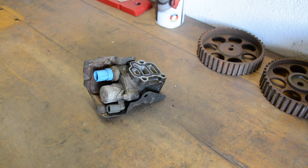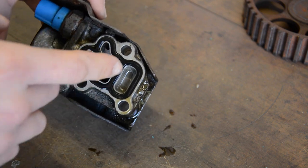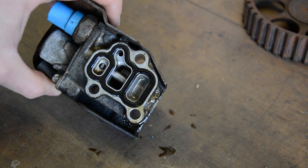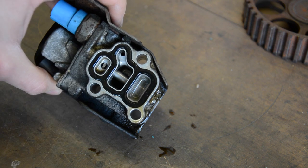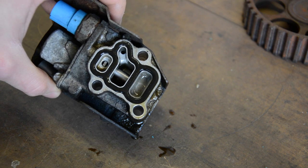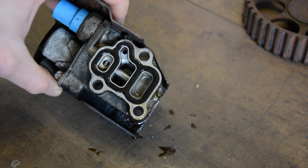Now, what could be wrong with this little piece? You can see this little filter on the solenoid. There's a metallic sieve in it which protects the solenoid from dirt particles in the engine oil. A delayed oil change could be the reason for dirty engine oil, and the metallic sieve gets clogged over time — until it's so clogged that the engine oil can't pass the filter. The result is that the VTEC system can't build up the oil pressure necessary to engage the VTEC.